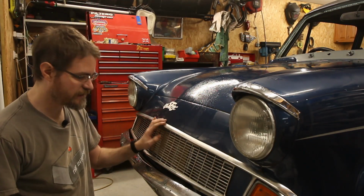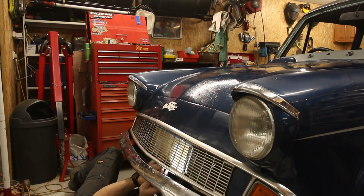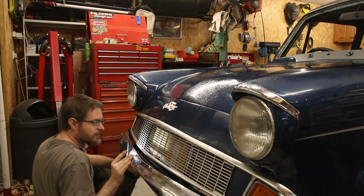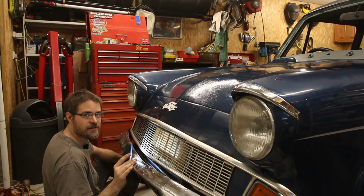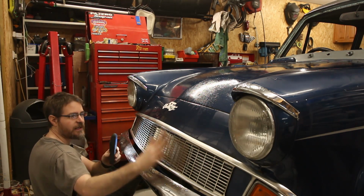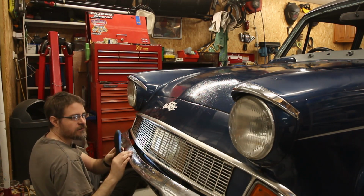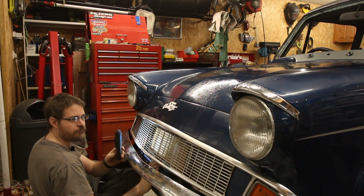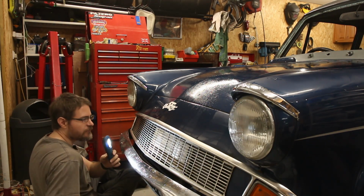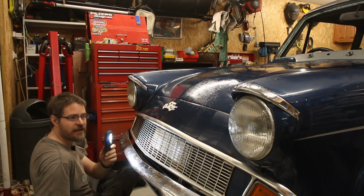Right, let's see what space we've got up here. Oh yes, plenty of room there, absolutely loads of room. And I can actually come down a bit as well. If I can come down by sort of 30 millimeters, then that will bring that Chargecooler right into the opening here, as the top half of it is hidden behind there. So yeah, I can bring that down as low as I want to also get these two mounts in. So yeah, plenty of clearance up here. Looking good. So I'll get the front back out again now.